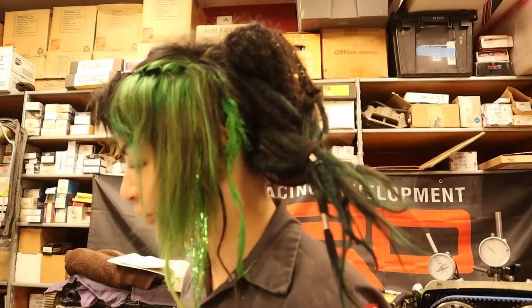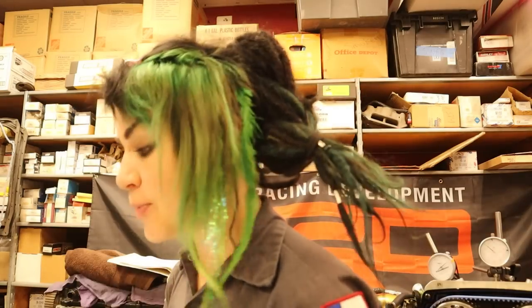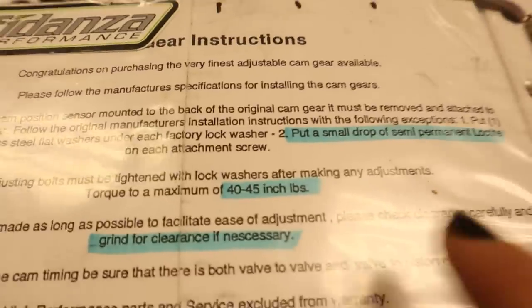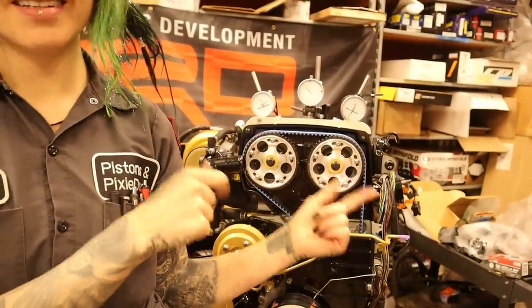I'm done with one major task, and now I will start another one — but this feels extremely good. Now on each single one of these little bolts I'm going to put some red Loctite. I'm going to back each one out one at a time — I don't want to mess up anything, it's so perfect now. Per the instructions, a small drop of semi-permanent Loctite on each attachment screw. I have a little bit of PTSD about my cam gears, so I'm actually going to use the full-strength stuff and then torque all of them to between 40 and 45 inch-pounds. That is my cam gears adjusted.